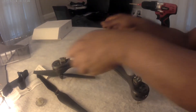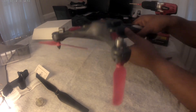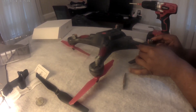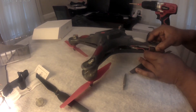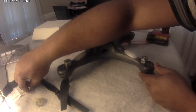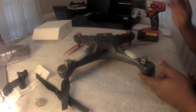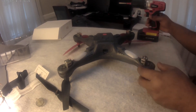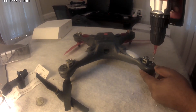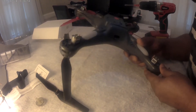It's pretty much the same thing, so put this piece back on the motor itself and then assemble everything. It's just a reverse of what we did earlier and we have to make sure everything is inside. Yeah, that's one of the disadvantages of having to take everything apart, as opposed to just dealing with one side. If the pieces were designed so you could deal only with the affected area without taking everything apart, it would be much more reasonable. Be careful to replace every screw, because if you miss any one it makes it unstable. It's a game of patience and just being careful.